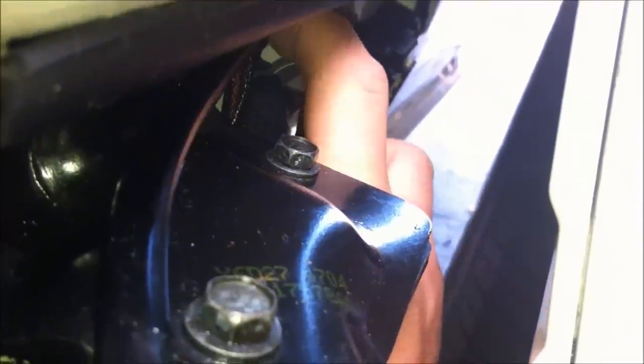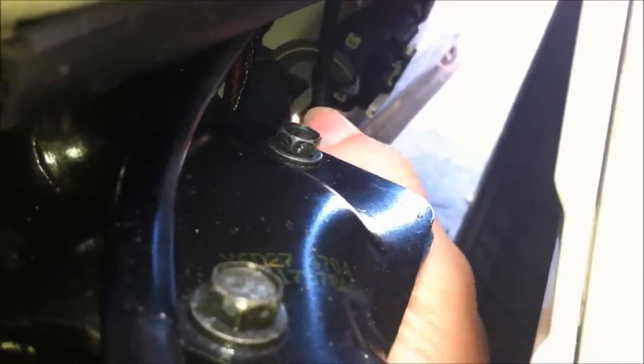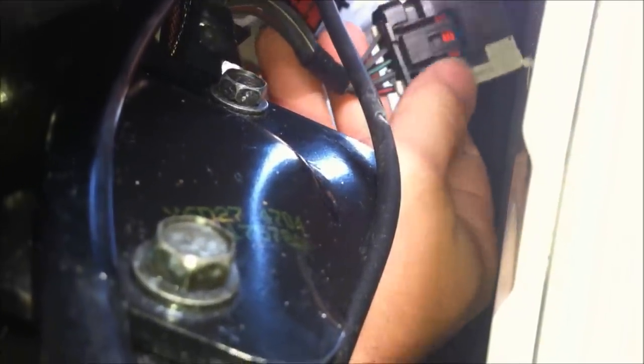Next, there's a little wiring harness right here with a plug on it, and the wiring harness comes across here. There's a tiny piece down inside that pushes into the door to hold the hard wiring harness part. First, lift the little cable up and push it out of the way. Then pull the tab downward — that unlocks the clip and also unlocks the connector. Push the detent and wiggle the plug, and it will unplug. The plug is out.